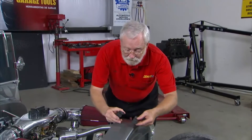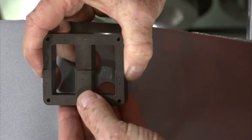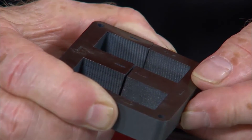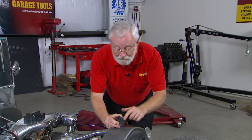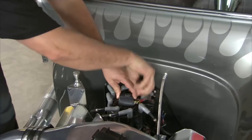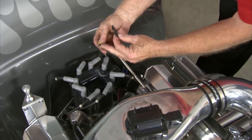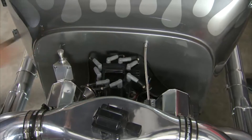I want to show you how that works. These are the laminations called E-bar laminations inside of an HEI coil. What I want you to look at is this air gap right here. By controlling the width of that air gap, we can control where the spark energy will occur up and down the RPM scale. And also by controlling this width, we can control cold weather starting issues as well. So besides manipulating the E-gap, having a great turn ratio, good insulation, this new HEI coil is going to solve the spark issue. And some brand new plugs are going to help too. This is the little carbon brush, the insulator, and we will have to lube this insulator as we put the new coil in. And don't forget the ground strap.